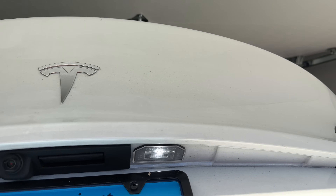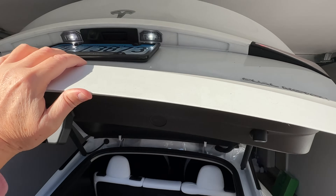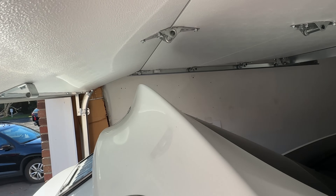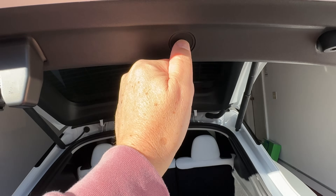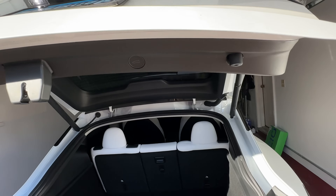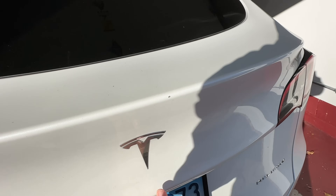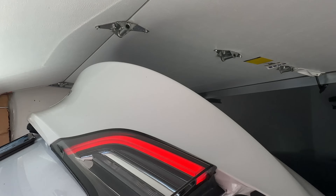The way to fix this problem is you can push the lift gate up manually with your hand as far as you want it to go — maybe like right about there. Then all you have to do is push this little button for about three seconds. Listen — you hear the little chime. Once you hear the chime, you know that it has set at the highest setting, or whatever custom setting you want. So now the trick is when you open this — let's see — there it does. It stops. Instead of smacking in, it stops.